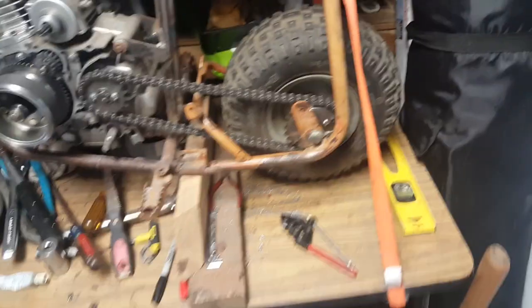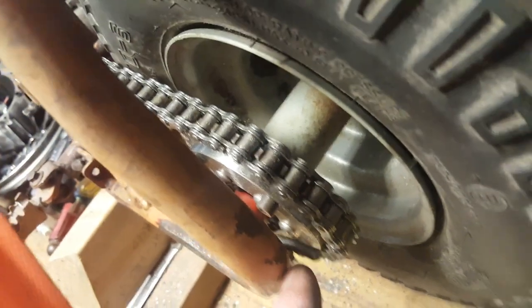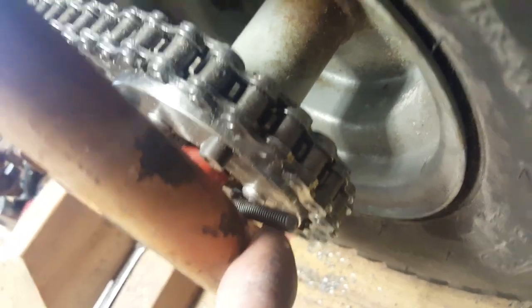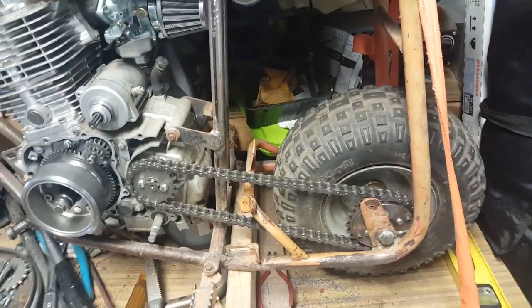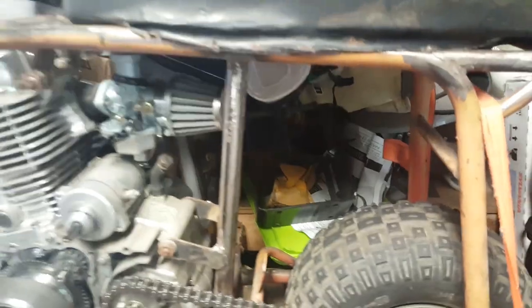One more thing — the adjuster comes out next to the frame. What I'm going to do is get a little piece of pipe not much bigger than the diameter of this bolt, weld that to the frame, and tighten my nut up against it — that's what will allow the wheel to be pulled back to the appropriate spot. I'm going to have to mount the battery probably up here, as close as I can get it to the frame, somewhere in that area. I do have a fender that goes on here as well.